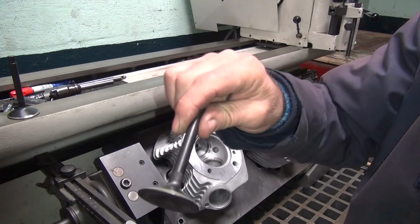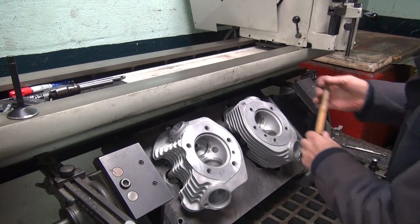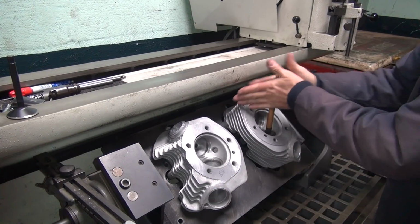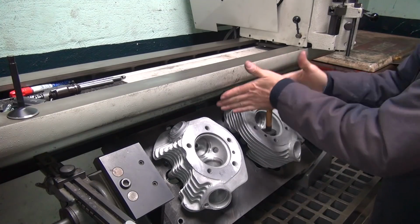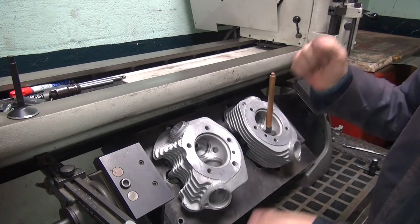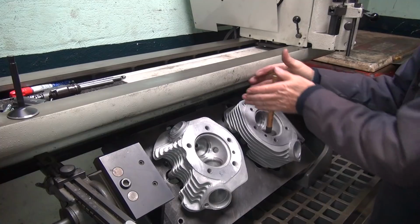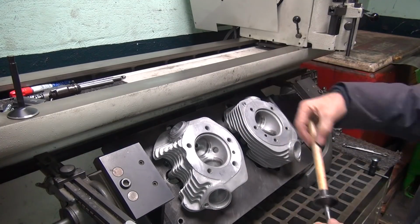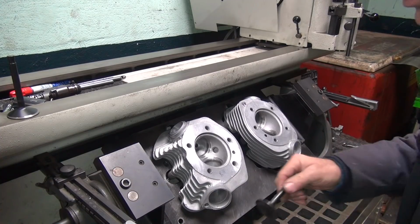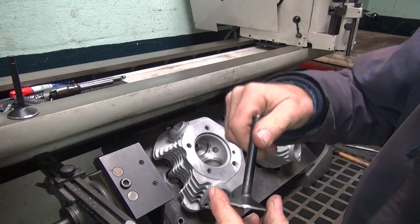Okay, so now we're going to take this valve and lap it. We'll also see what the seat looks like, and hopefully everything's on center. Sounds good. That's a good sign. Usually if the valve won't spin, it's locked up solid. That's not a good sign. You can hear it when it comes down nice and even sounding. It releases cleanly. And that usually means you're pretty good. You get a good idea what things sound like over time, what's good and bad.